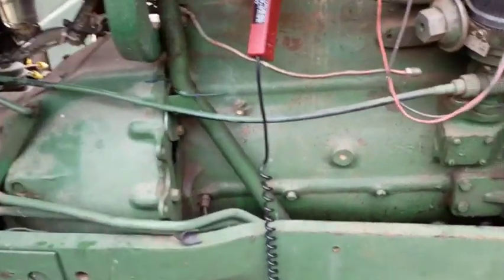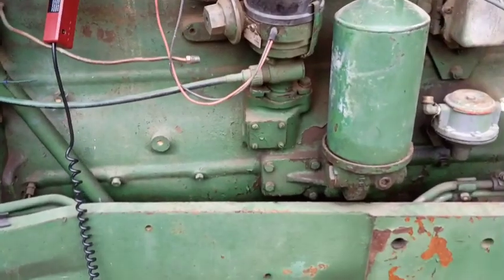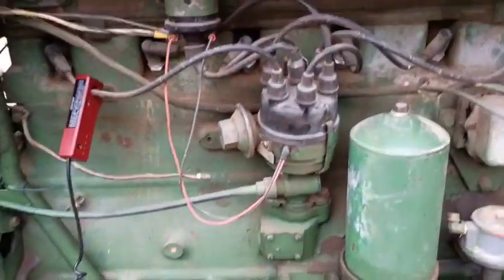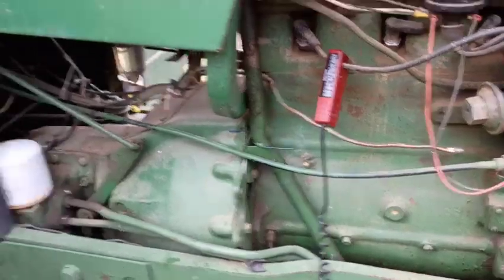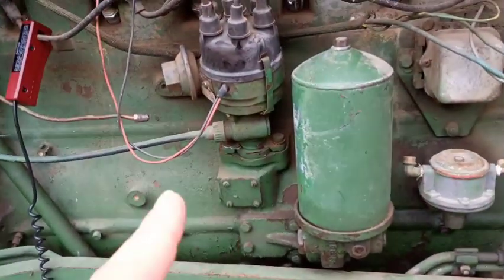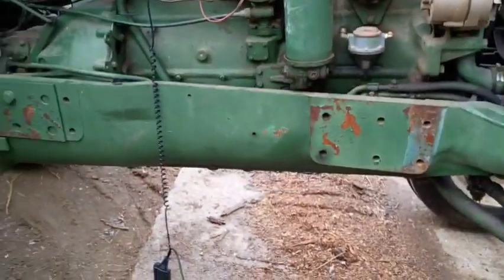But yeah, otherwise I'm going to get new governor springs, because his tabs, I don't know. Maybe it'd be fine to bend them out. Actually, it's pretty close, because it's supposed to be with this disconnected, so that's very close. And it's not supposed to be quite full throttle. So it's 2400 RPM, and it's supposed to be 24 advance, which is pretty close to that. So I'm going to start over and try it again.